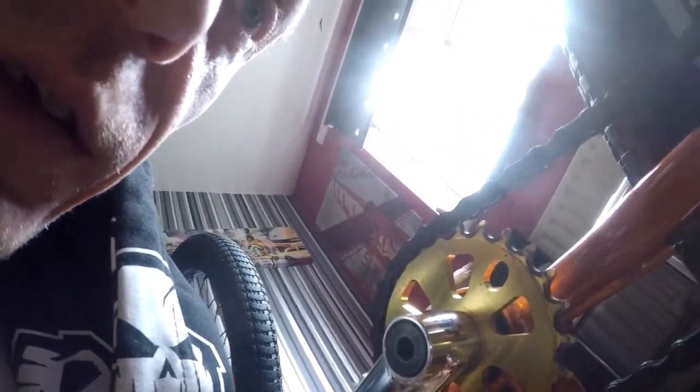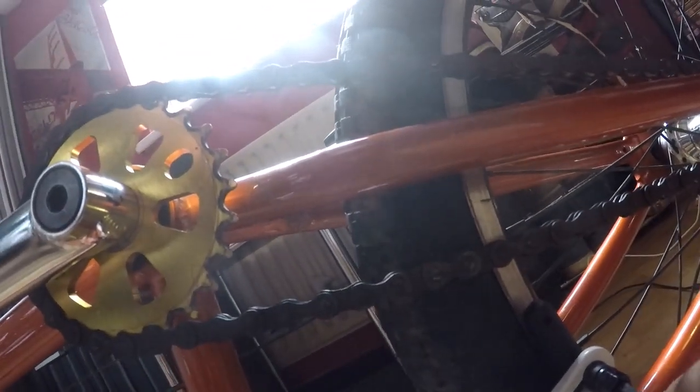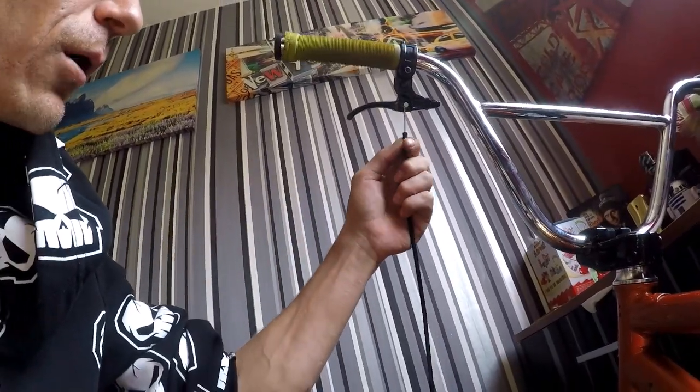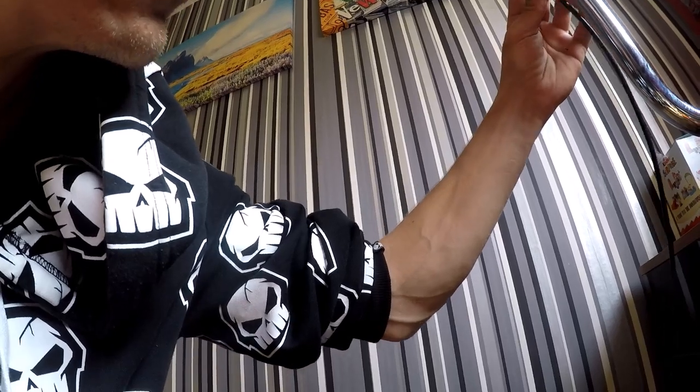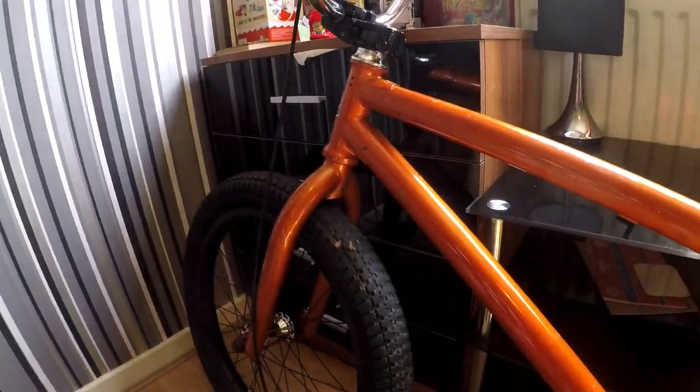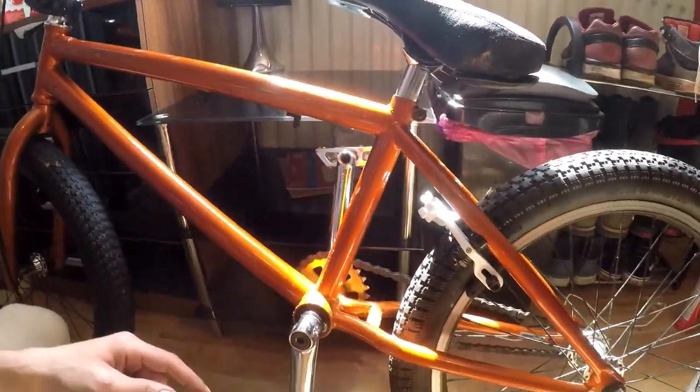Next step: the way you see your brake, you've got your rubber mount — literally just adjust it all the way on and then tighten it up. You can always use a spanner or an Allen key for this; I prefer to use an Allen key. Next step is to get this cable into your brake lever — all you do is pop it in like that, make sure it's lined up, pop it in and give it a twist so it stays there. I'm just going to figure out exactly where I want to thread the cable to get it to the back.